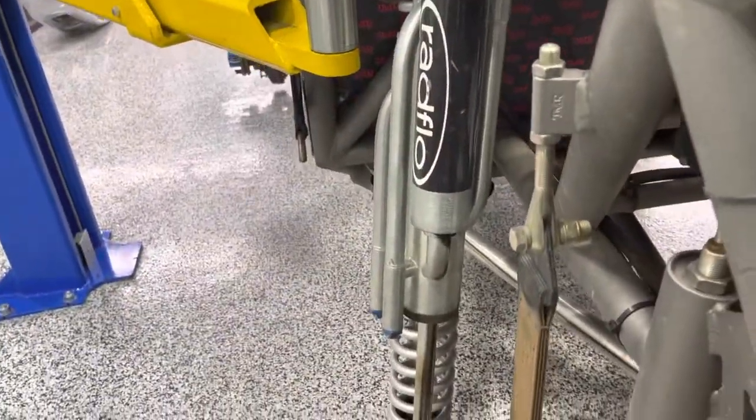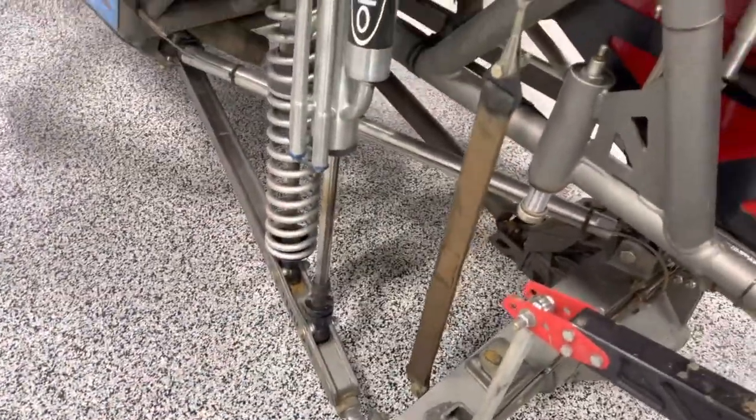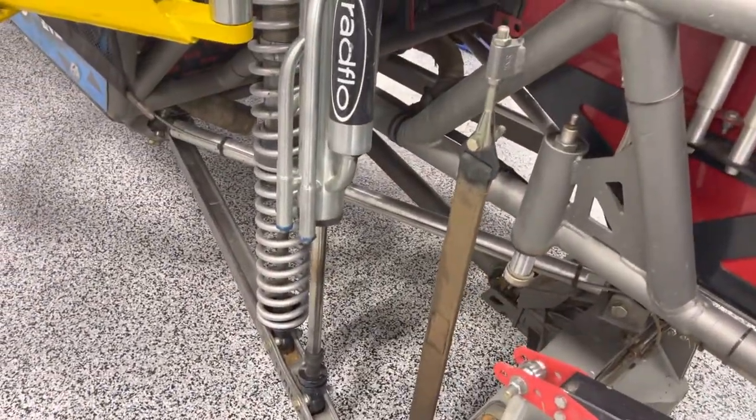What I want to show you is that the clevis is in line with the strap. So when the strap's loaded, we're just pulling straight on that clevis. We don't want the clevis to be angled straight and then have our mount way out on the axle with the strap being loaded up on an angle — that's going to want to pull or bend the clevis itself.